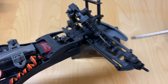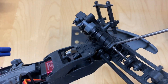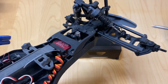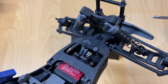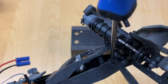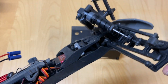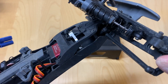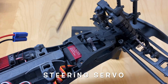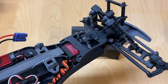Continuing in the front you have this upper chassis brace or upper front brace — it mounts on top and bolts to the main chassis here. This is obviously the chassis, the bathtub style chassis. Inside the steering area there's a bunch of different components — these two arms down here are called bell cranks, because they convert one direction of turning to another. That's just an automotive term. Bell cranks connect the steering to the servo. This is the servo — this is actually what turns the vehicle. When it gets a signal from the radio it sends it to this guy, and this actually turns the steering left and right.